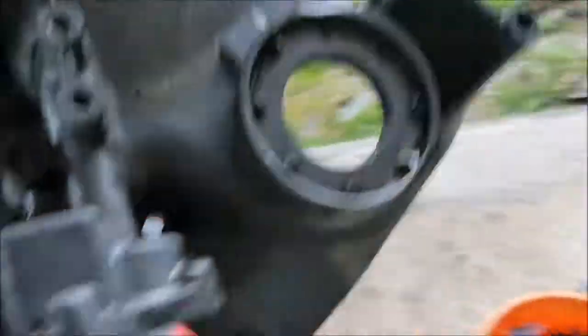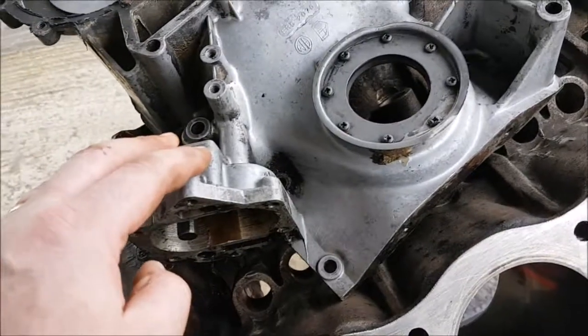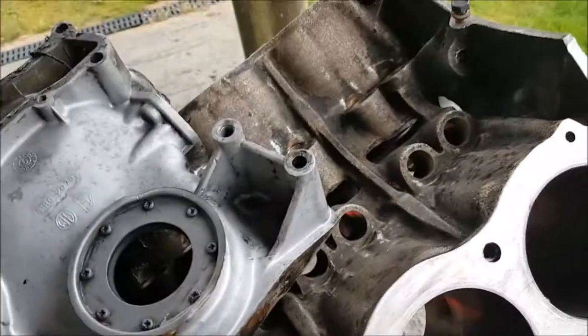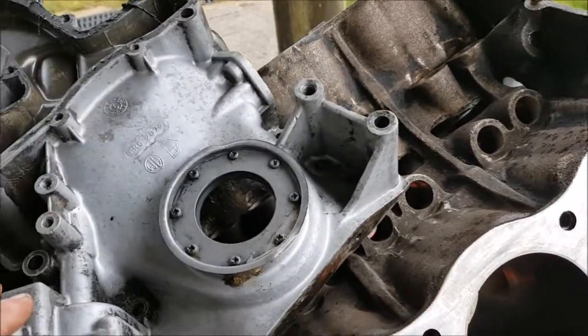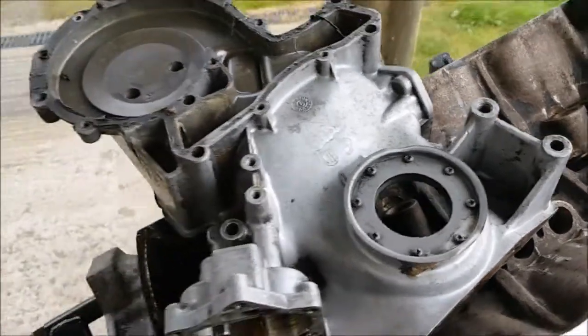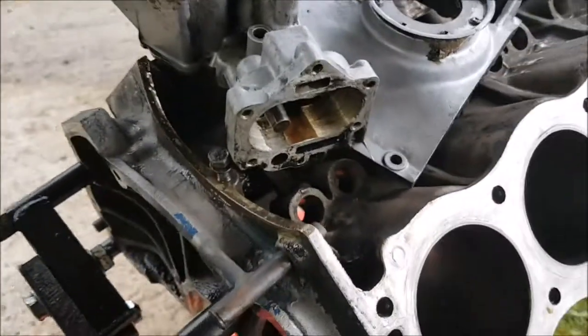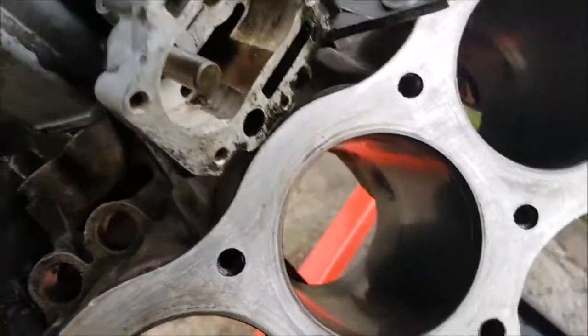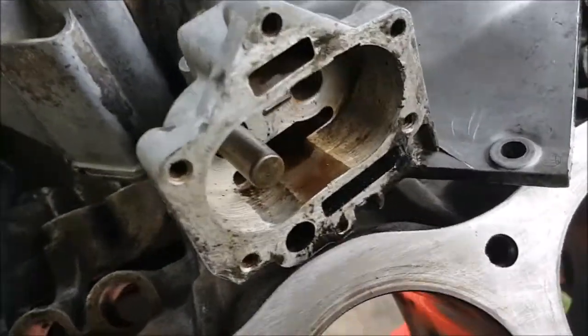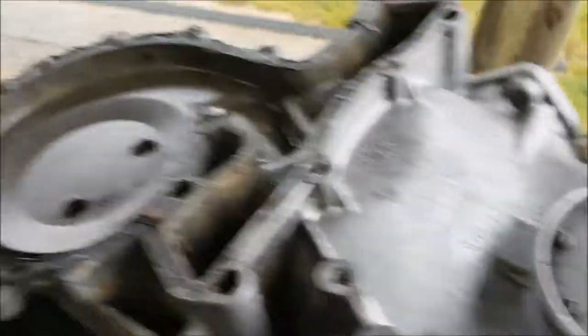So yeah, it's been a fun morning cleaning that up. The front cover, timing cover - look at him, he's come up all right. So that's one from a Range Rover, so this has been fitted onto this engine. I suspect this engine came out of some sort of Land Rover. It's got a low compression engine number and it had low compression pistons in it, but it's got the higher water pump which really indicates it came out of a Land Rover.